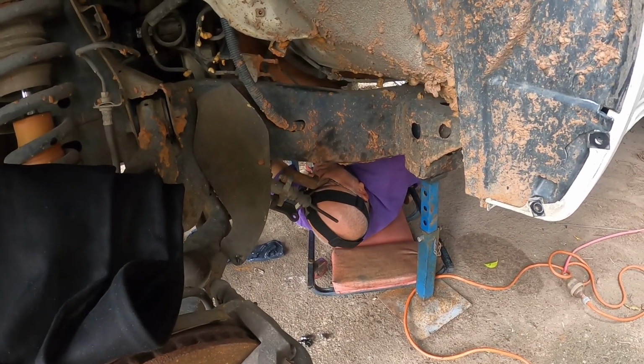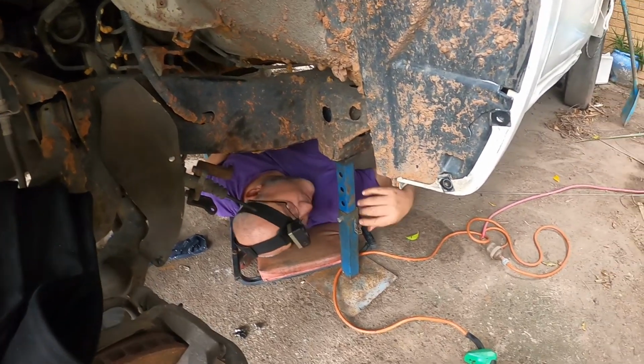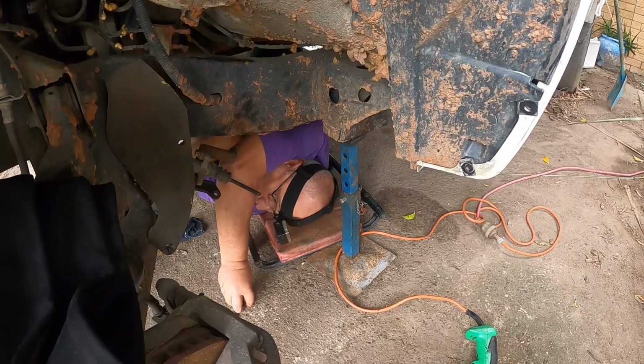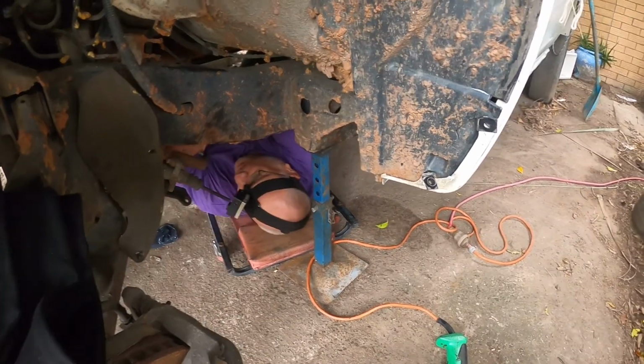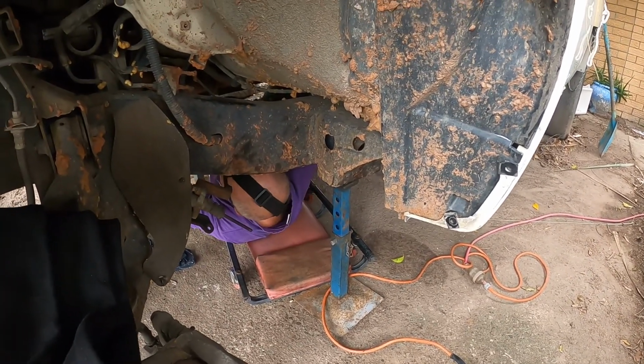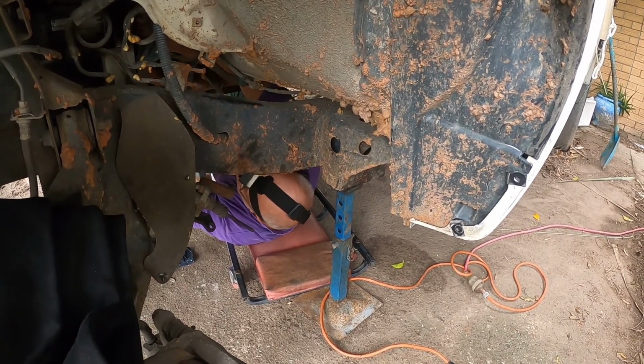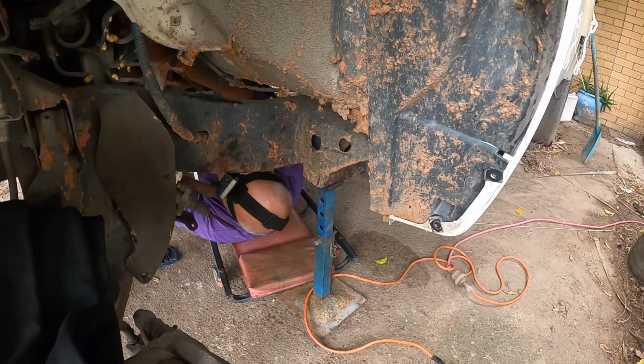Never put grease on any of these components. Never put grease. It's important you never put grease. What I do is I oil them a bit at the tip. That's all you need. Never put grease on the spigot shaft. You'll know it if you do.